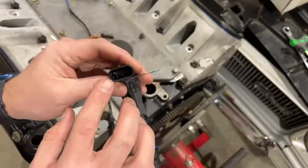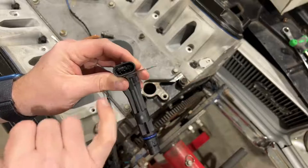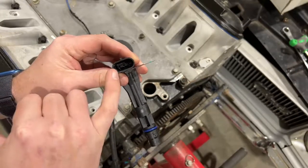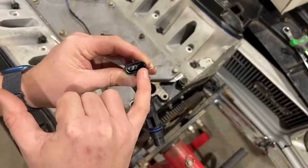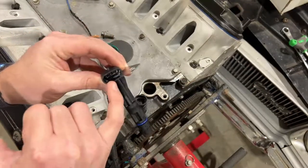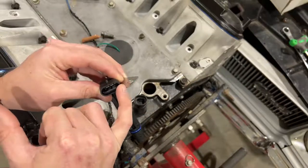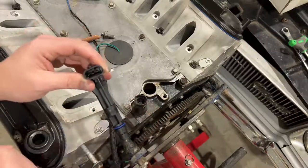You can see in here it is a three-wire sensor — your A, B, and C. Your A is generally going to be your positive, your five or twelve volts in. You have your ground, and then you have a five volt reference coming out from your C. So if you wanted to check it while it was in the vehicle and cranking, you would want to go from your ground on your B terminal to C to see what the effect is on your meter or your power probe.